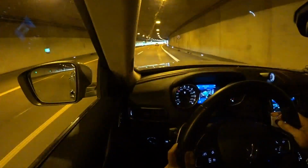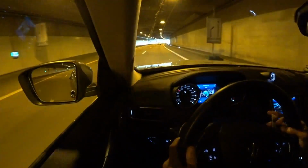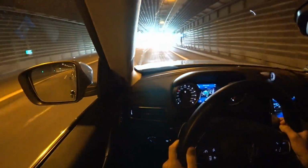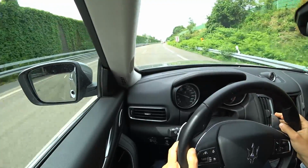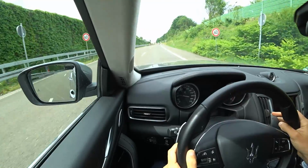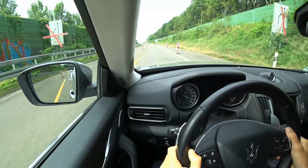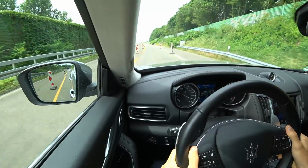And what we would have seen, I wanted to mount the speedometer when we had the acceleration, but I can drop down a little bit in speed and then show you that. So when I press the throttle a little bit harder, then you see that it goes more in the direction of 50-50 out to the front. See, now it's 60 here, so I can drop down even, like this. Yeah, about 35% now, just for that short throttle boost. So you can see it's always changing with the torque distribution.